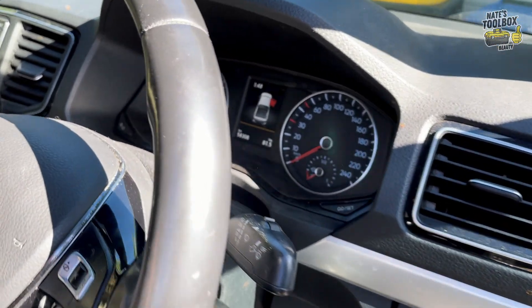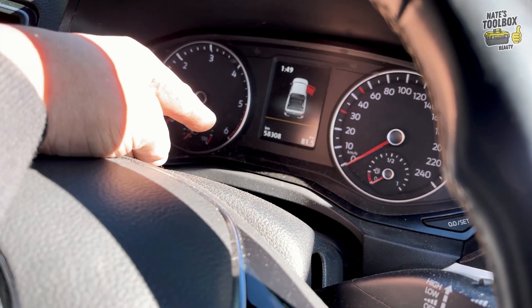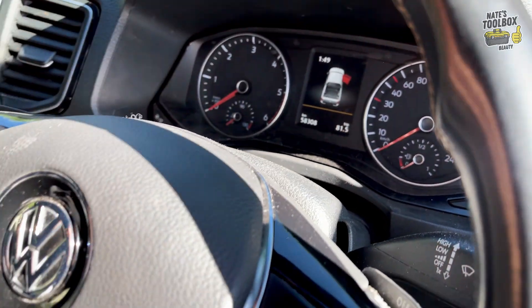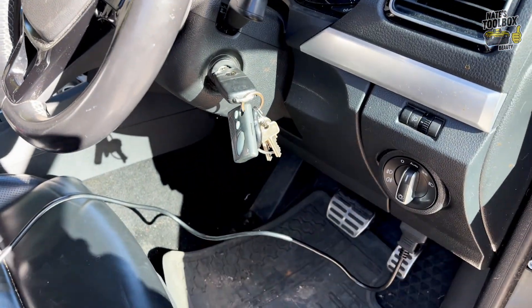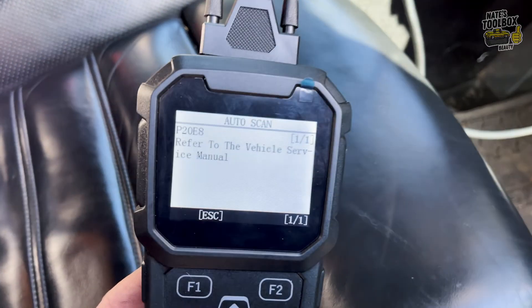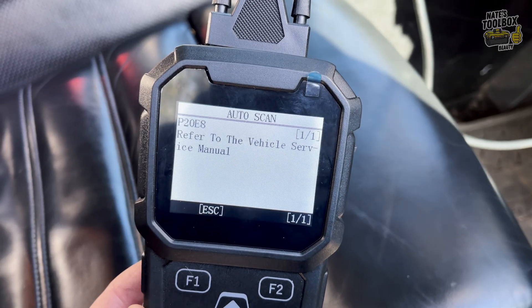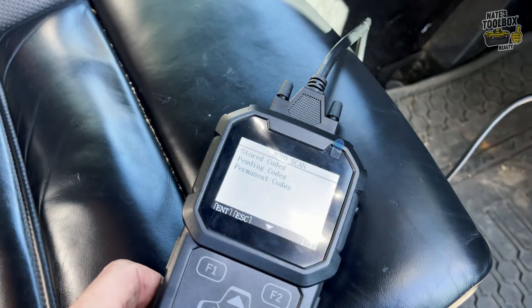I'm in the Amarok and it's come up with an engine light. It's actually gone out for a bit now since I'm doing a video — it decided to go away, but it could also be because I went to remove the injector for the AdBlue, which may have dislodged some contaminants. The error code we've still got stored is P20E8, stored in the system at the moment.